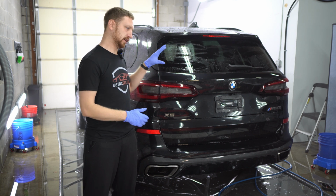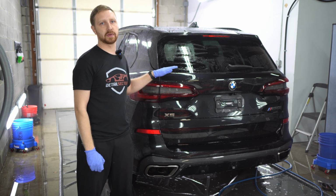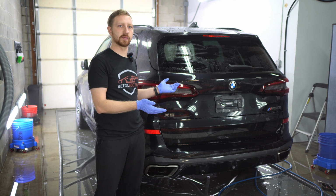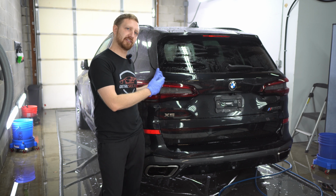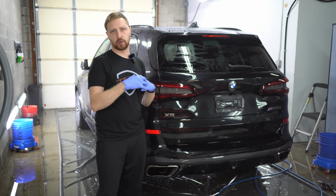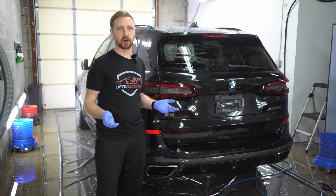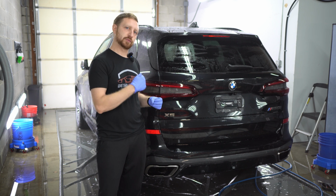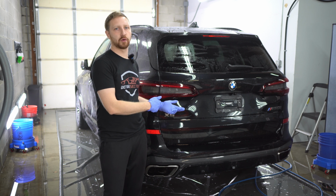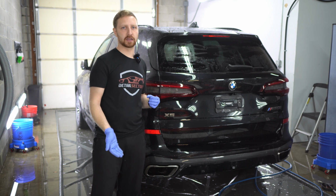And you're making sure that the water-beading characteristics and the self-cleaning characteristics of the coating are still gonna be performing like day one, whereas the protective qualities are generally always gonna be there. It's just the water beading and self-cleaning properties come from that gel deteriorating over time. You wanna keep replenishing that. So we do have a maintenance product that you can also use on your car called SP3 Maintain. Spray that on, it'll last for about 3 months. You can use it at home. It'll help you maintain the coating at home and make sure that the water behavior is exactly like the day that you picked it up from the shop.